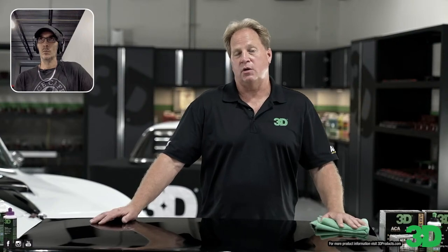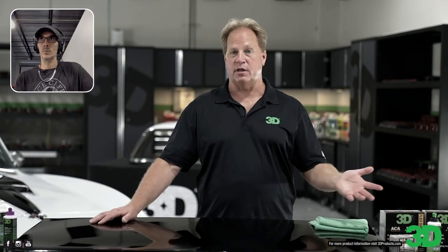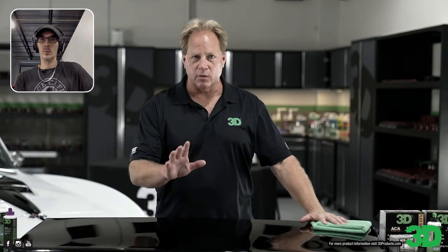But I do get it that there are some countries where the only tool that's available or affordable is a rotary, so it is a concern to them. They don't have access to all the cool orbitals we have here in the United States. Well, that is very true. Hey, if you got to use what you got to use. I was about ready to say the exact same thing. This is where doing a test spot comes in. If you're going to use a rotary only on a car, and every car can have different paint, you want to find a horizontal surface, dial in your process, and inspect it nine ways of Sunday. Make sure it's perfect before you buff out the entire car.